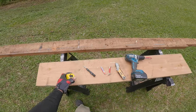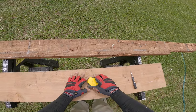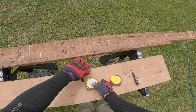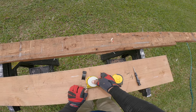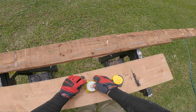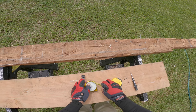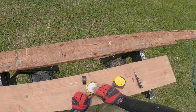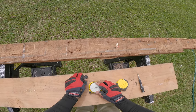My tape needed a major adjustment, but if you just want to add a little bit of tension, you can do this: pop the back of your case off carefully, make sure you're holding down the white reel at all times, take the brake out, then finagle the silver piece out from where it's locked in. Get just enough tape out to pass over all the plastic parts, rotate it around once, making sure to push down on the white reel the whole time — do not let it come out or up. Get that silver piece locked back in, then pop the brake back in.